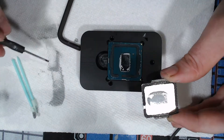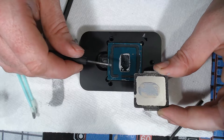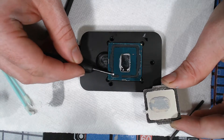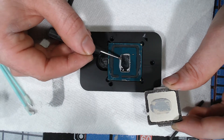The thermal paste is pretty good about holding things together. It's just if you're delidding for friends, you wouldn't want to transport it delidded and not sealed. If you're going to transport it, you'd probably want to seal it back. Scrape this off, scrape this off. This is the old thermal paste you can see. This is the substrate.